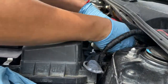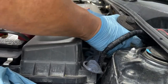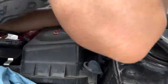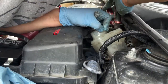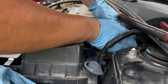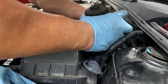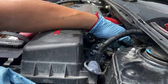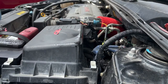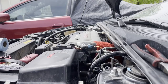This is fast-forwarded so I'm not actually going this crazy — it's just so you guys don't get bored watching me taking that reservoir for like 20 minutes. You also have to remove a 10-millimeter bolt that's holding it. Using the impact gun to remove that will give you more room to work. Put the rack underneath to catch any fluid.